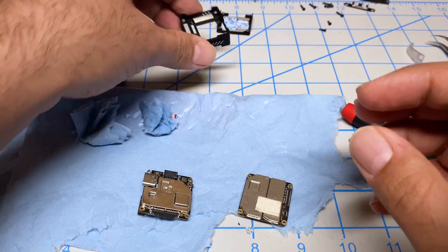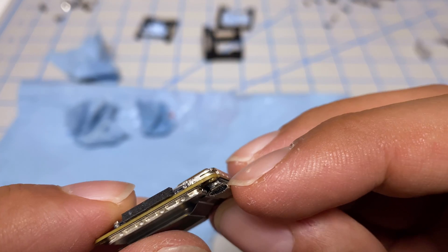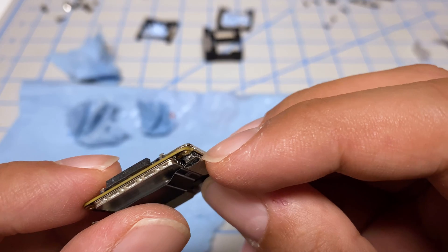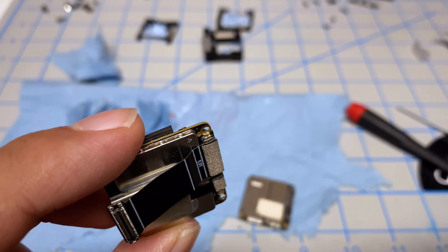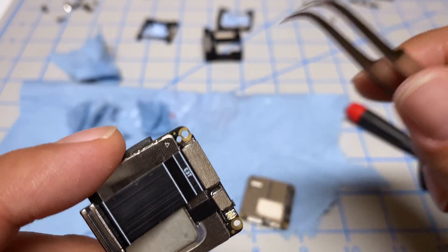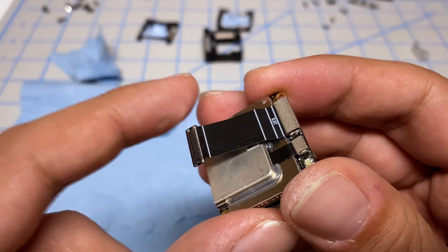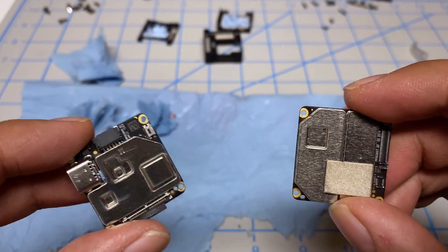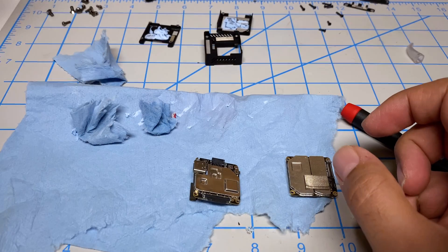That's where it gets a little tricky and you need quite a bit of patience. Typically you just get your nail underneath the connector and pop it off, but DJI has glued the ribbon cable to the board. So you have to break that glue first. I took my tweezers and just slowly picked at it until it disconnected. Once you do that, you can pop the cable off. Make sure you get all the glue out, otherwise you will break that connector. Once done, the two boards come apart simply. There's a heat transfer pad on there — I used 99% alcohol to get it all cleaned up.